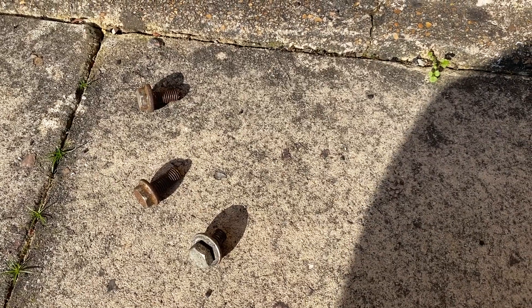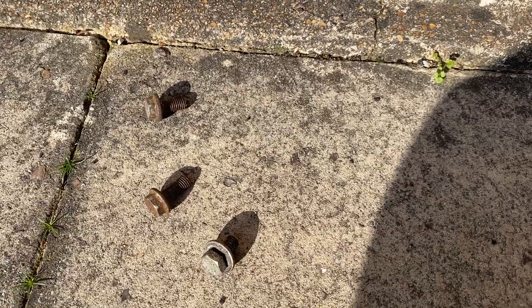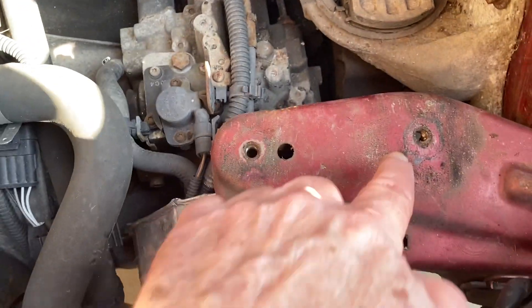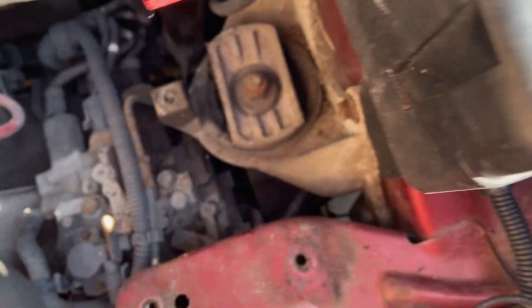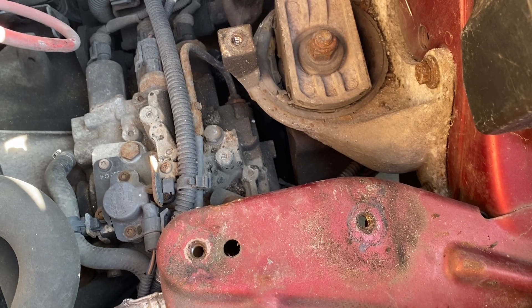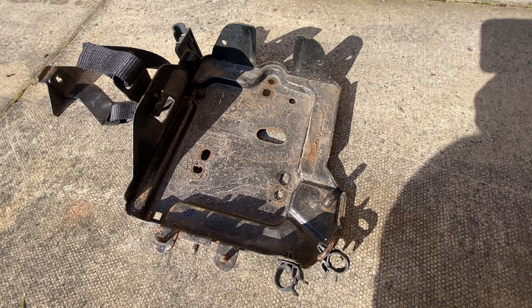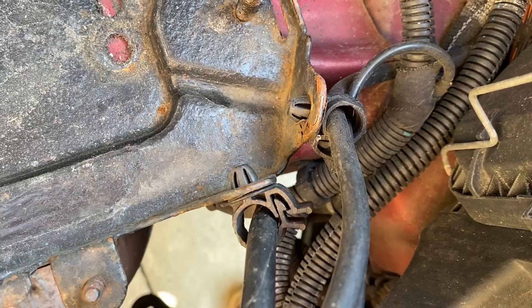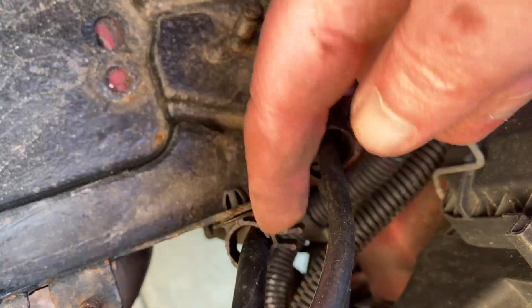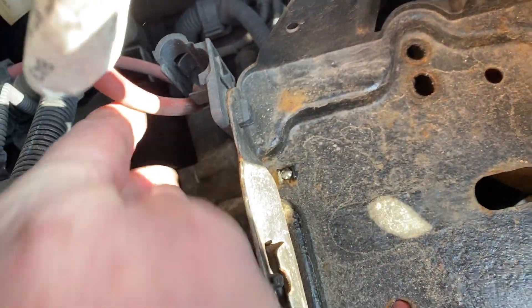Now I'm going to put the battery tray back in. It's held in by three bolts: one at the back and two at the front, left and right. Then we clip up the various cables around the side. It's worth checking when you get this out whether the tray is quite rusty - if it is, give it a good wire brush down and a coat of Hammerite paint. Make sure you tuck these cables nicely into the clips, including one at the back corner, then tighten it all up.